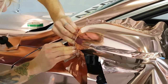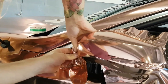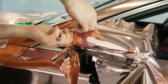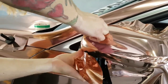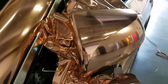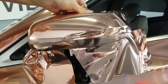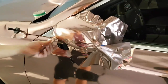Once I'm done this I'm going to show you how the film is cut using knifeless tape. Because a lot of brands like Avery, Arlon, or Hexis — their chrome frays when you use knifeless on it. I'm actually using knifeless, not wrap cut — you can use either. I like wrap cut because it's very strong, but it doesn't bend quite as easily as knifeless does. Just making sure we're fully covered. Other than some fingerprints on the mirror, there's no hazing, no damage — it looks great. It's going to last because now we're going to tuck it around all these edges and post heat everything.